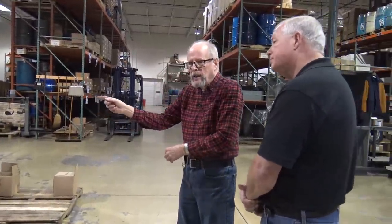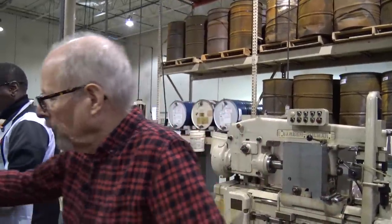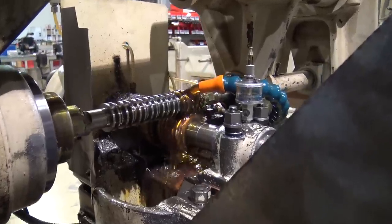These machines are older than Tim's parents — this one is from 1913 and that one over there is from 1909. These are hobbing machines; they put the teeth on the sprockets. We do nine sprockets at a time. Tyrone is my key man — he's been with the company longer than I've owned it, starting right out of high school. The hob works its way down toward the front, putting teeth on the sprocket, with nine sprockets on that arbor.